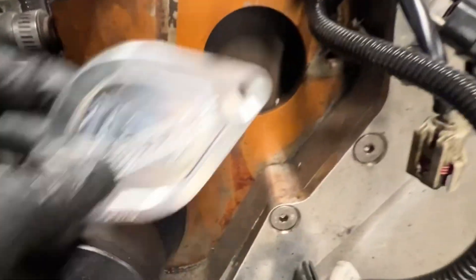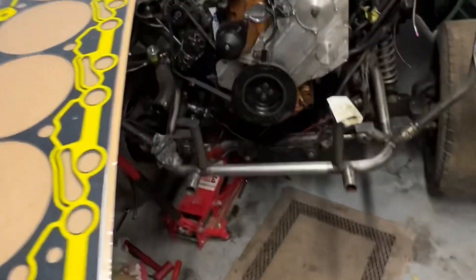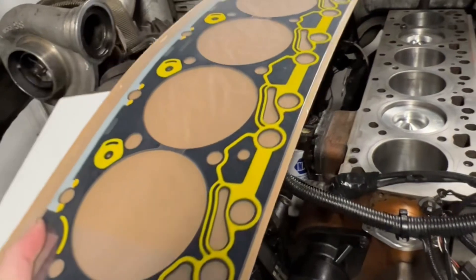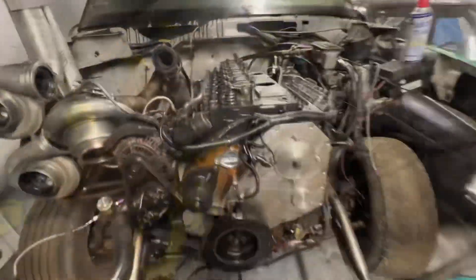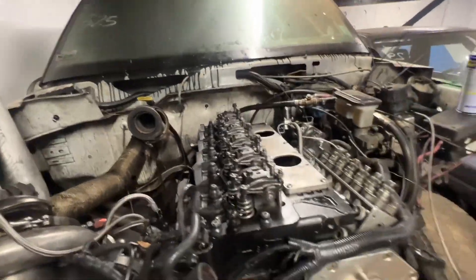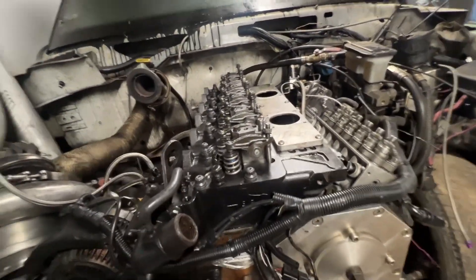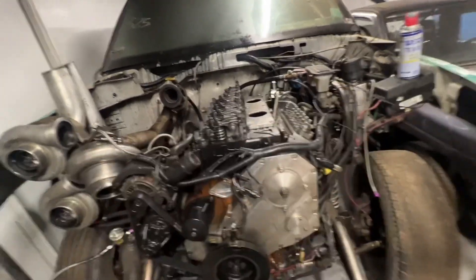When the windshield got covered with water at 140-something miles an hour, that was the culprit. To fight that, I got a nice billet piece from Keating — popped that in. Got a fresh Hamilton head gasket going on — special thanks to Matt and Cat at Sisq Diesel for always hooking me up with good deals on parts. Head is sitting on there with all the studs in, push rods and rockers set.